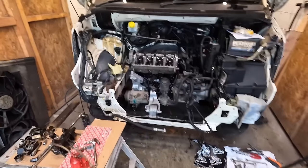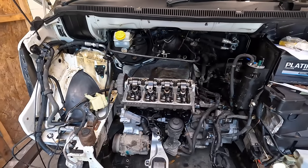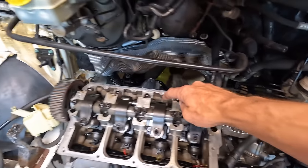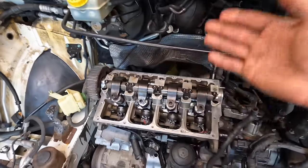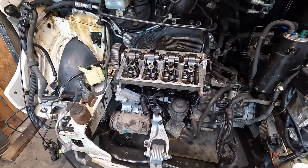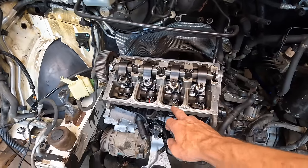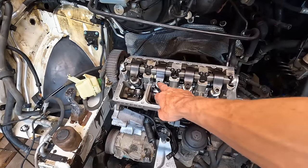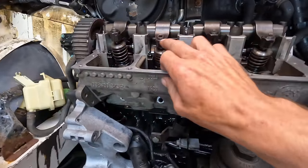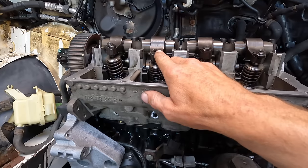We're back. We've done the service, got that back to him. He's happy. We got the cylinder head finished in the time lapse. And I've literally lubed every cam lobe with some oil, because as soon as you first turn it over, if they're dry, you're going to absolutely obliterate stuff. So we've lubed it all up, got all the injector loom in, and then we have adjusted the injector valve lash. If I scoot down here, the injector valve lash is basically like an adjustable tappet.